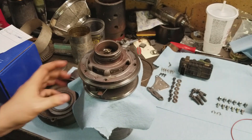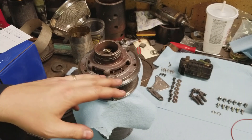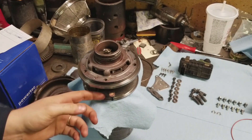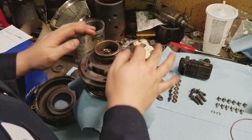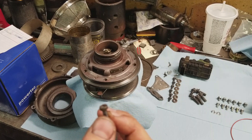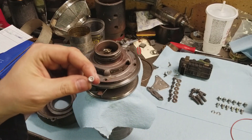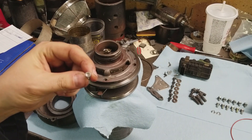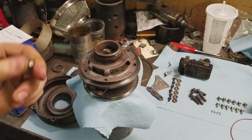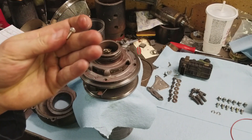It's clocked in the correct position, and again you can see the vanes here. The exhaust gases are going to come in this way, open it up, and they're going to come out the end of the turbo and then to your exhaust pipe. The bolts that hold this thing on — I broke two out of the five, so I got new bolts. These are originally Torx T25; the replacements are Allen. I'm going to go ahead and put these bolts in using Loctite on them to make sure they hold.